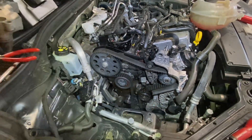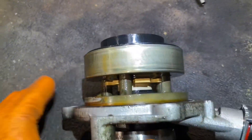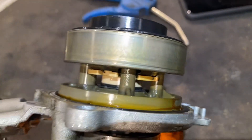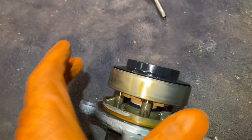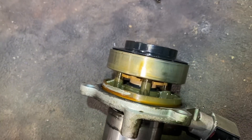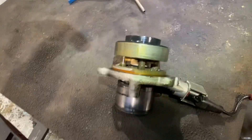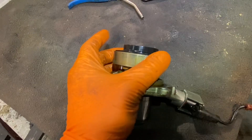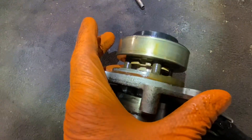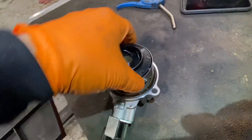Here's our pump that is out, and you can actually see that the shroud is stuck out and over the actual impeller. That should not be — its home resting position is back in there with the impeller exposed and doing its job. We'll give it a little push.